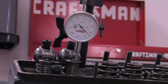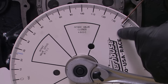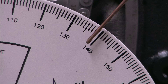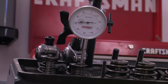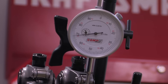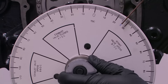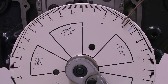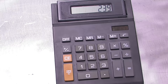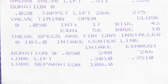Rotate the engine slowly clockwise until the indicator shows 76 thousandths of an inch of lift at the valve and look at the degree wheel. Count the degrees from either TDC or BDC, whichever is closer. Bottom dead center is marked as 180 degrees on this wheel, but while checking duration, we'll consider it zero. Since the BDC marker is closer, we'll count up from there and get 42 degrees. Continue rotating the engine through camshaft max lift and stop when the lifter is 76 thousandths of an inch away from closing. All measurements should be made with the engine turning clockwise because any slack in the timing chain can throw off your readings if you spin the engine backwards. The number we got for valve close is 17 degrees. To find duration, add your opening number plus your closing number plus 180 degrees — so 17 plus 42 plus 180 equals 239. Comp tells us the rated duration at 50 thousandths inch lobe lift is 240 degrees, and that one degree of error is realistically inconsequential.